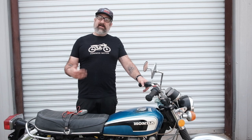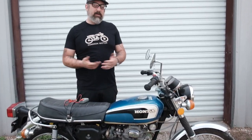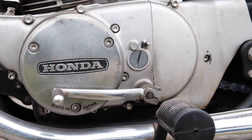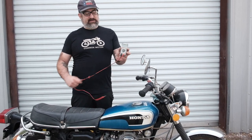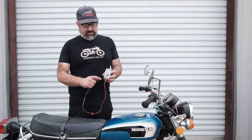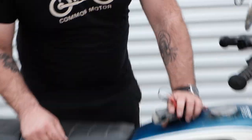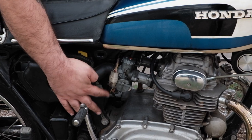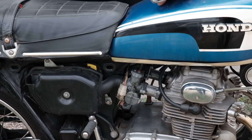We brought out our shop CB175, which has the same type of charging system as the 350s, 360s, and 450s. We're going to do two different tests on the bike — this is a running bike. First we're going to do an AC stator test to see the voltages coming out of the stator. Then we're going to do a DC test at the battery to show what the voltage changes are. I've pulled the stator plug out here so you guys can see it — that's my plug coming out of the stator coil going into the harness. We're going to tap into it when the bike's running and show you the values.